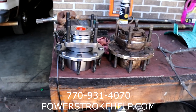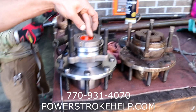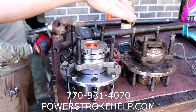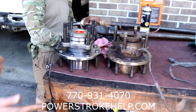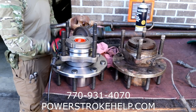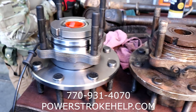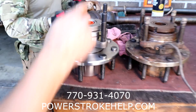Mikey, start from the beginning about the breather tube. We take it apart and we see all this rust. Now, this is very common for this bearing to have this problem due to water intrusion. You definitely want the grease in there, but water gets in there, these parts rust, and this is where you get the damage. How does the water get in there? In this case, this hub assembly has several seals on it - it's supposed to maintain a vacuum for automatic locking and also keeps the water out. In his case, we did a little research and found that the vacuum tube over here was off the truck. At some point he submerged the front end - and it rains in Florida. Water got into this assembly and rotted out this bearing.